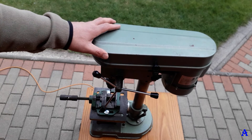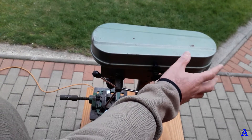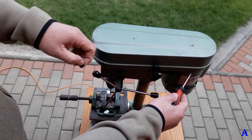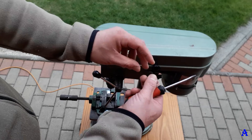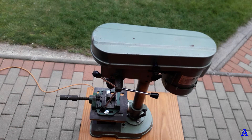If your machine is making strange noises, there's a good chance that the screws on the top of the motor are touching the metal cover. What you have to do is take a flat screwdriver, use it as a lever, and push a small O-ring — like plumbers use — into place there. That will solve your problem.